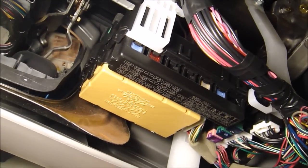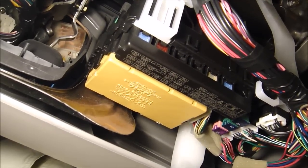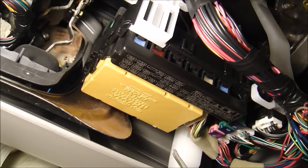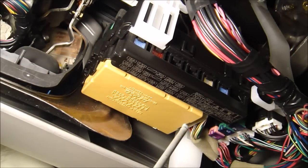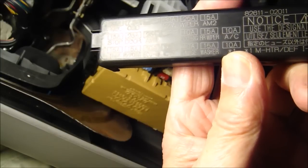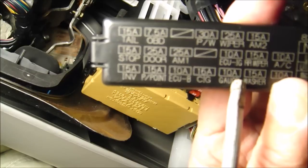Okay, this is what I see from down under. This is the fuse box — a narrow, rectangular, black box. It is installed upside down, and on the top of the cover are the locations of all the fuses inside. To open the cover, push the tab here and pull the cover up. The cigarette lighter fuse is this one — on the bottom row, marked 15A, CIG.